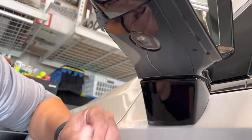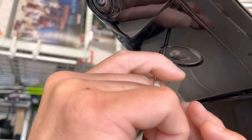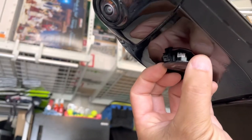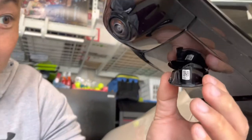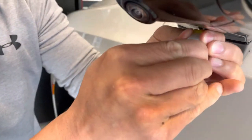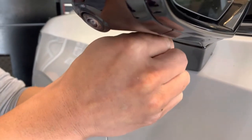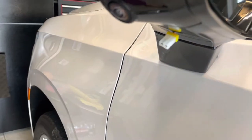You're going to want to push the screwdriver inward and then down and it'll just pop right up. Point the camera right here at this notch — you will see this little notch, push in and it pops right open. Get something small enough that fits, pops right open, and gently take it out. Pull this guy out gently and there you go.